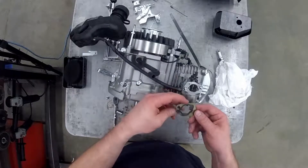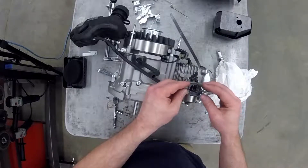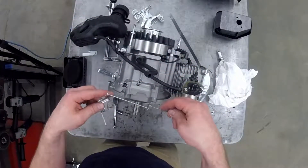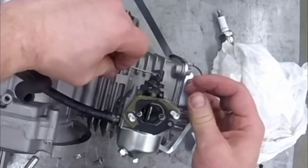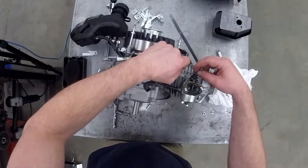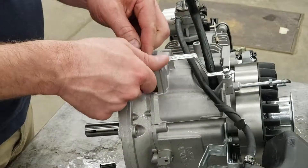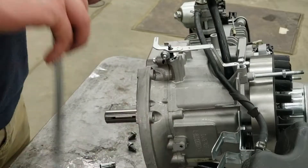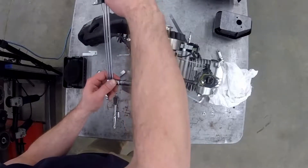The last carburetor gasket will go on just before the air filter housing — slide that on. Now we've got a bunch of rods. This is the throttle control rod with the governor lever. The throttle control rod will push right down into the throttle linkage and just pop right down, just like it popped out. Then hook up the spring to the little hole right beside it. Slide the governor lever on and tighten up the pinch bolt — that squeezes and pinches that lever around the rod that goes inside the engine to regulate the engine speed.